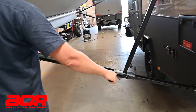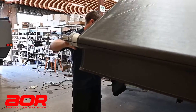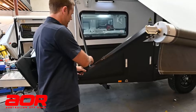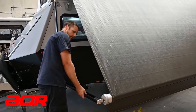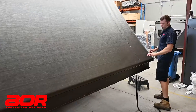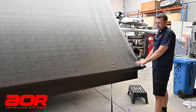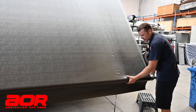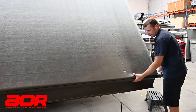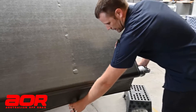Now we can slide these down. Lower our awning arm. Same thing — slide the top down, lower our awning arm. When operating the awning and rolling it back up, you will always need to remember to take a slight bit of tension off the ratchet, as it is a ratchet. You need to take half a flick around to disengage the teeth of the ratchet.